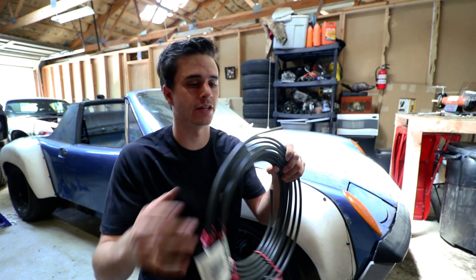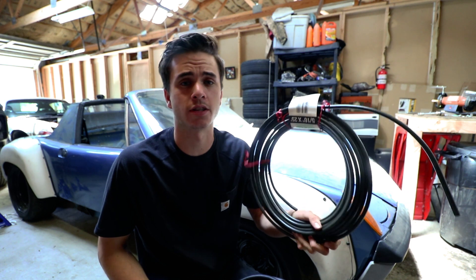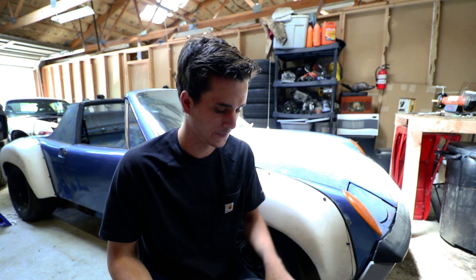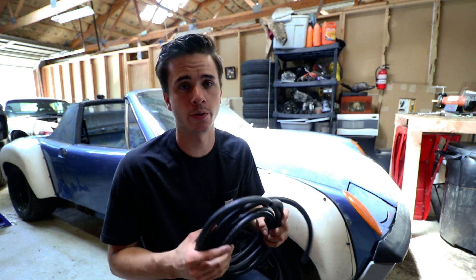The previous owner also struggled with doing some weird modifications and the tubing is already like rock hard. It's missing a hose clamp and I can't get to it without taking the tank out, so we need to pull the fuel tank out. I've got some hard lines here that we can run hopefully through the tunnel where the stock lines go, because steel is gonna be a lot better than plastic, and then just a whole bunch of standard rubber line — it's a stock Subaru engine, so I don't need any fancy AN fittings or lines.